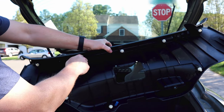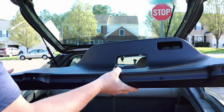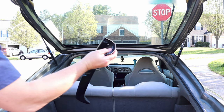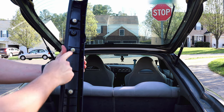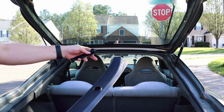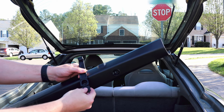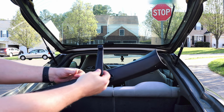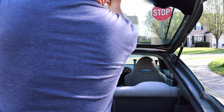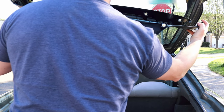There are five across that front edge that are really difficult — push forward and down quite forcefully and that will pop the remainders out. The side trim pieces each have three pop pins and a screw. The screw holds the hangers for the deck of the car — that fake netting deck that comes up when the hatch opens. If you pop the cap off, you can see there's a Phillips screw in there on each side. When removing these, you want to remove the side trim pieces before the large piece, because you need to push the large piece forward and these side pieces will get in your way.